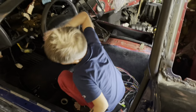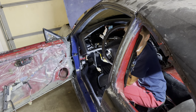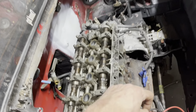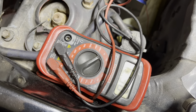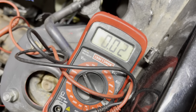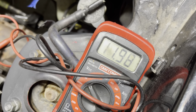Take two — I realized there's a clutch pedal in there and it's down all the way, triggering the clutch safety switches. That was the issue. Asking Marcus to try again — and there we go, the starter is engaging. The clutch switch was preventing the start signal from going through. Problem solved.